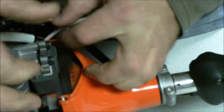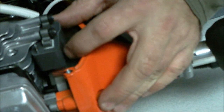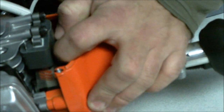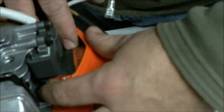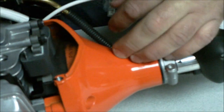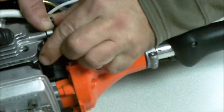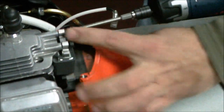Get the feeler gauge in there, and then when you pull the flywheel over, it's magnetized so when it gets directly underneath the coil it will suck the coil down to it. That will give you the proper distance between your ignition coil and your flywheel. Once you've got it there, hold down on it to make sure it's snugged, then tighten these back down.